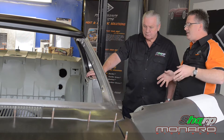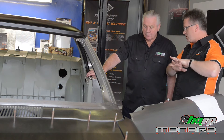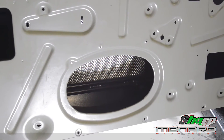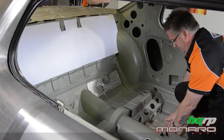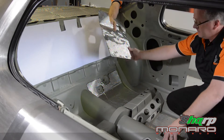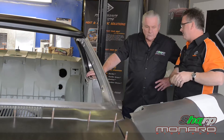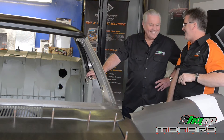The advantage of the product is you don't have to, like other products, do every square inch of the floor. The material being an OE tier 1 grade material, you don't need to do every single area. You just have to do the critical little spots — where you tap the panel and it sounds drummy, that's the area you need to attack. Sounds like I could even do it. It certainly does.